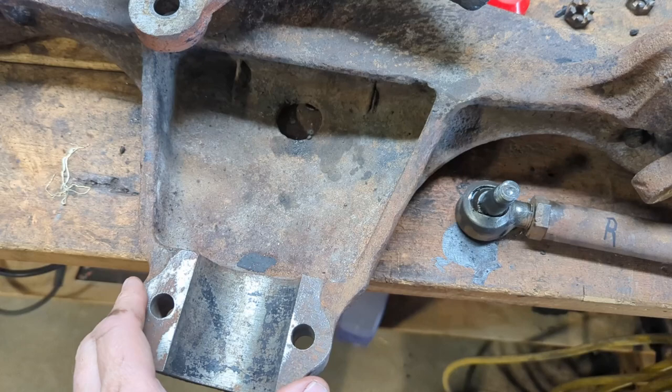I tightened this castle nut up a little bit — still turns. The service manual shows these tie rod ends with grease zerks in them, but these do not have grease zerks, so I'm going to have to squirt some grease in on those. My next project is to replace the grease zerks — I don't want any of them plugged up. There are three of them. I'll replace those, grease everything up, then make those o-ring gasket-type cushions and put it all back together — the steering gear axle rebuilt.